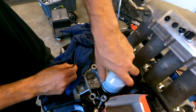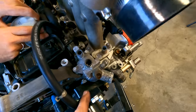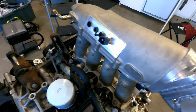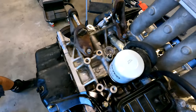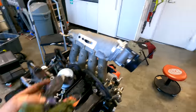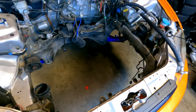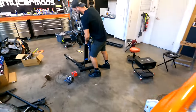Easiest oil filter change ever — done. So what's left to do: you'll notice there are a couple of sensors that are not plugged in — coolant temp, oil pressure, air temp, really basic stuff. Alternator — I need a little bit of wiring, but we can do that in the car. We can do all that stuff with the engine in because you still get a bit of space up and under here. Since the K frame is right at the back, we have the choice of going in from underneath or up from the top.